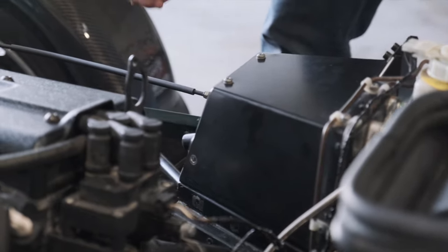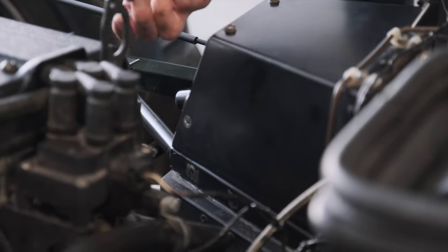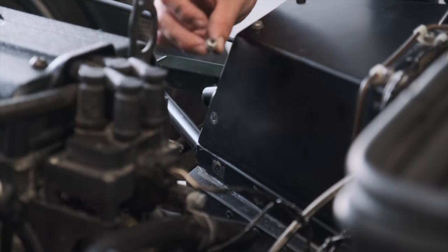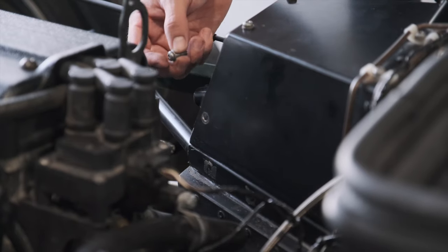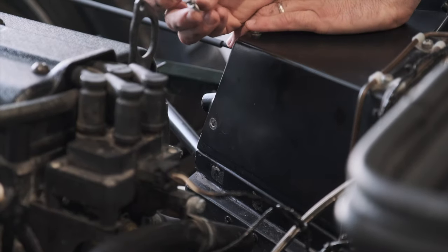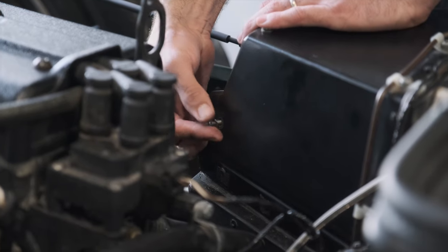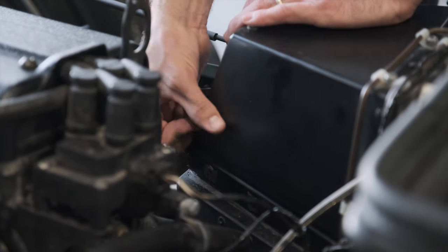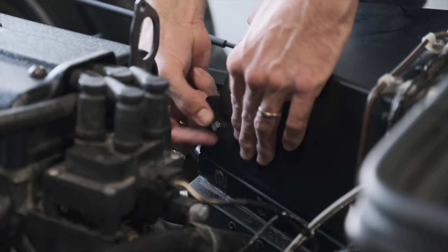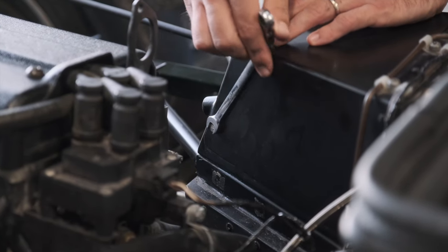We've deliberately left this last one until the end because the screw that we took out of it is incredibly difficult to get out for the nature of it being a Phillips head screw. And that's mostly because the access is terrible. So we're going to replace that with an M5 hex head bolt, which will go straight through the same hole. And we can do up largely with our fingers. And then when it comes to nipping it up, we can just get a nice 8mm spanner on the end